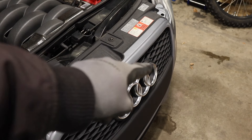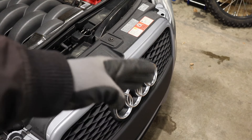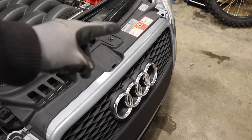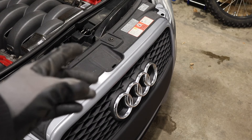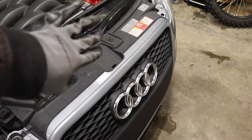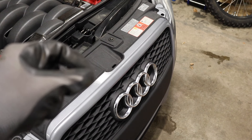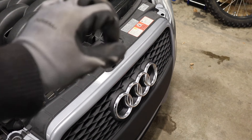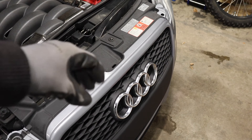For this clip we go back to the water pump area. The water pump — I inserted the hex shaft first when it popped out and then put the water pump onto it and clipped it in. You might think it would be better to get the hex shaft onto the water pump and shove it all the way in, but the problem is it also runs through the power steering pump. If you rotate that hex shaft while it's halfway in, you might misalign the hex that goes all the way through to the oil pump side.